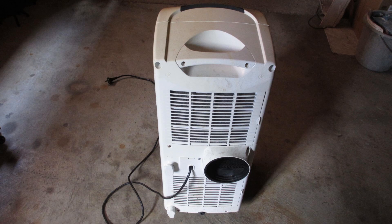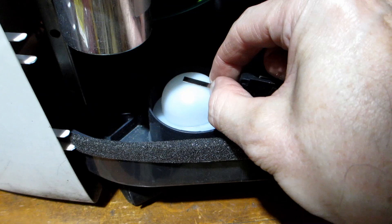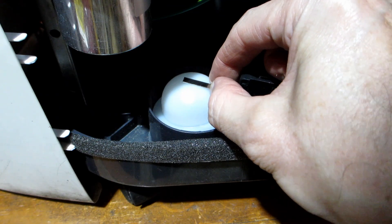The back cover is held with six screws on the back, four underneath, and one on each side — the two handle screws don't hold it. The first thing I check is the micro switch, and it's not in the down position; it's just always on.